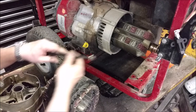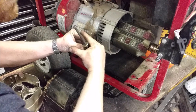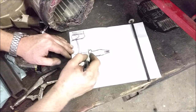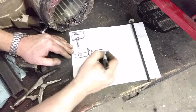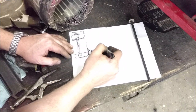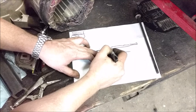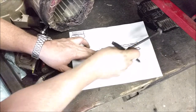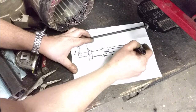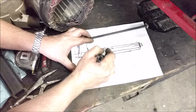On the very end here, I removed just this long bolt that doesn't retain much pressure but is enough to pinch it on that taper. The way you get it off: you have your main crankshaft that sticks outside the engine with a threaded hole. Your rotor has a sleeve all the way through it — essentially hollow — and this bolt runs down through the entire thing and threads in, just pinching it on the taper.